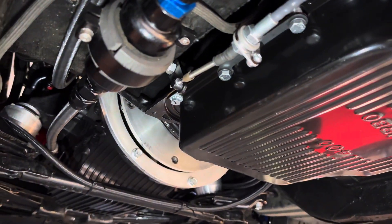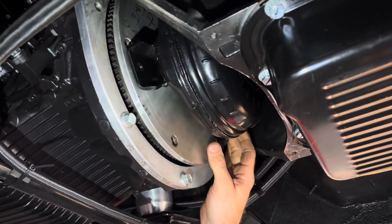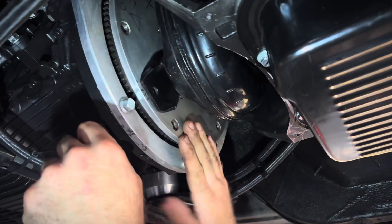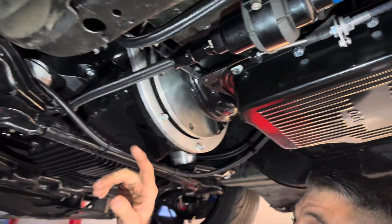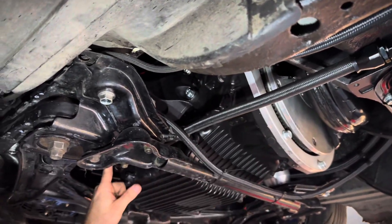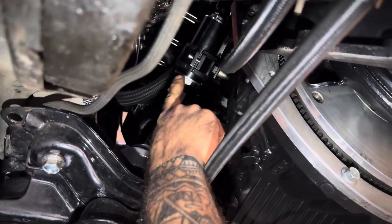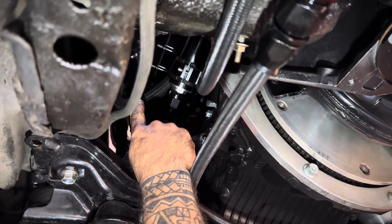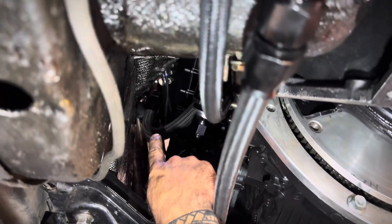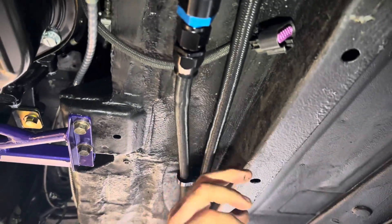I also need to bolt in my torque converter - I've got to measure some clearances between the adapter and the torque converter, and then we're going to bolt that up, probably in the next video. Fuel lines are all in now. The mechanical fuel pump is all done and bolted in. Up here there's another fuel filter between the mechanical pump and the injectors, all hard-bolted in. Look at the massive intake. The vacuum lines have all been done. I haven't actually showed you the fuel system yet - we've got the feed and return lines, plus another fuel filter as well.